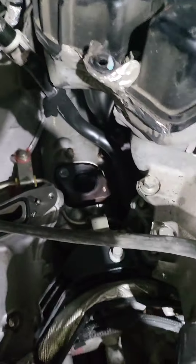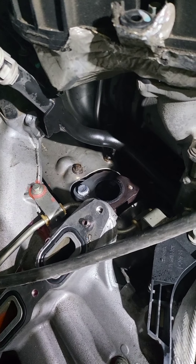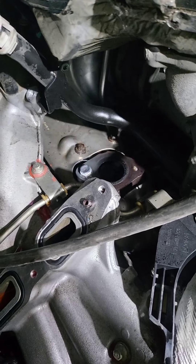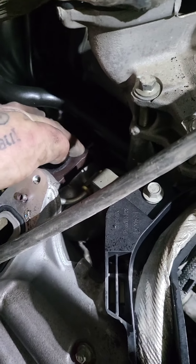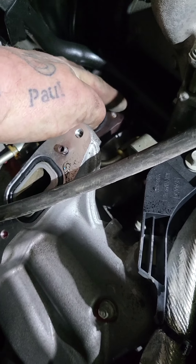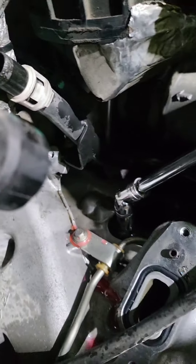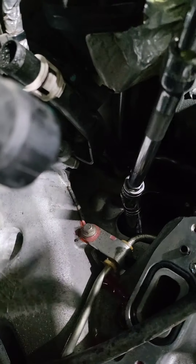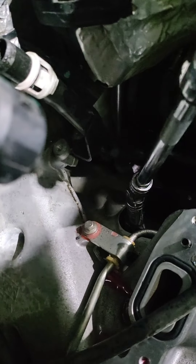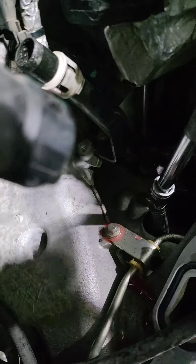That's how I fix it right there — you can see I welded a nut on that one right there. I welded a nut on there and got it turning back and forth, so I'm going to get that one out and then weld the nut on the other one. Before I weld the nut on, I build a little weld pile on top of the old bolt that's broke off. That way I don't have to try to weld with too much stuff down along next to it — it'll hold it up. I weld it, hit it a couple times, bring it out so it's above the surface, and throw the nut on there and weld it. These bolts, once you weld it on there, it's really easy to go too far, so you've got to be really careful. When you turn it, just put it on there and turn it a little bit. Once it starts to stop, you don't force it because they will break right back off.